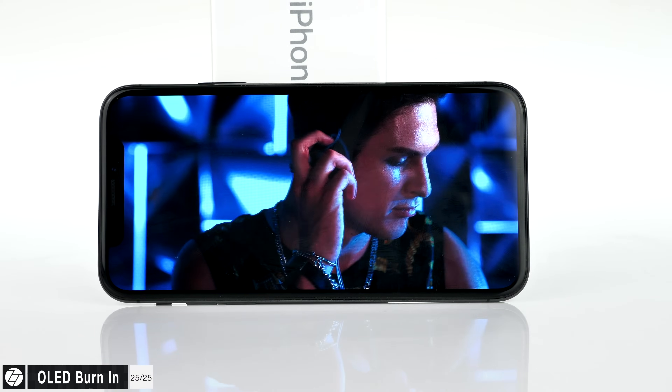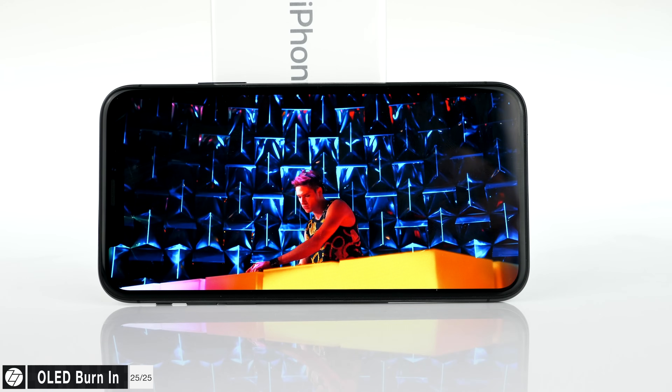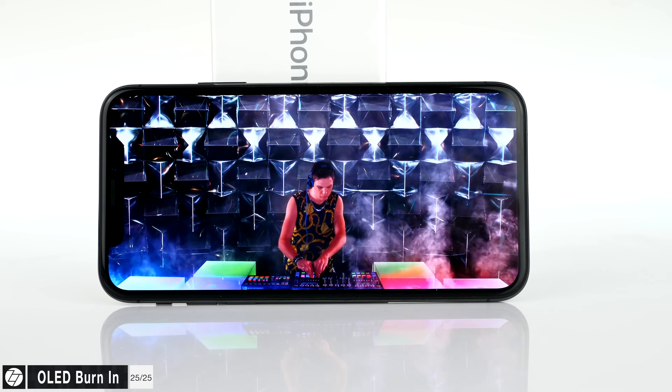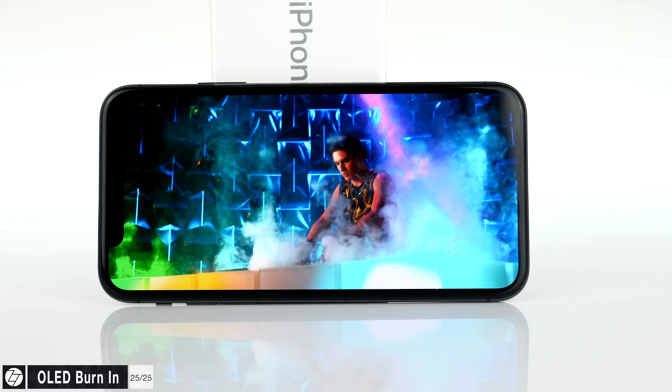Since the iPhone X comes with an OLED display, OLED displays actually will have burn-in. Apple acknowledges this on their website, so the only way to avoid burn-in is to avoid keeping the same image on your display for long periods of time. For example, don't use an app that displays the same artwork in the same places for more than 20 minutes. Try pausing the app or switching to a different one every 20 minutes or so. Don't keep the screen static.